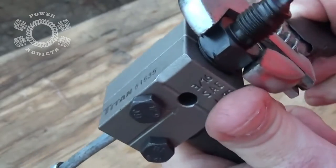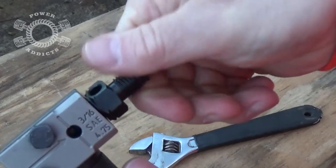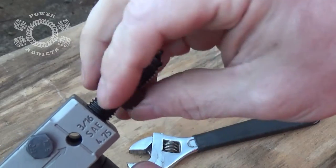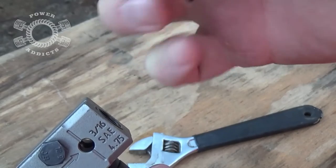Before you get too crazy, look over here — if you see little abrasion marks on the tubing outside the clamp, that means your brake line slid out on you. Right now I've got no abrasion marks, so the brake line is locked in good. Once the hex body is against the block, that die has done its job. Back it out — I have to go off camera for a minute to get the leverage to break it loose.